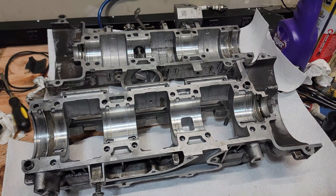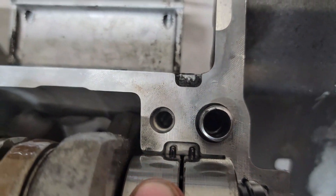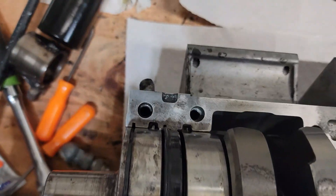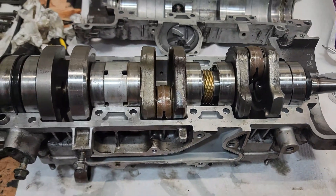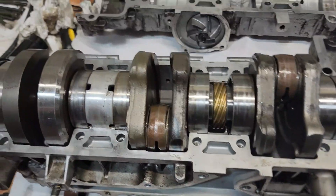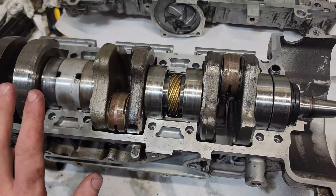Now that all that's done, we're ready to drop the crankshaft in. I got the crankshaft in — everything lines up good. Make sure you get the dowel pins into the grooves on the case, with one on each bearing. The seals fit into their grooves as well. I rotated everything a few times and nothing is binding. Make sure you put assembly lube on everything so the bearings aren't dry on first start until the oil starts circulating.